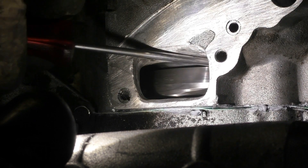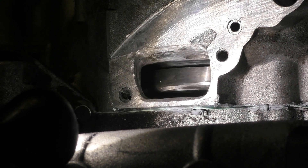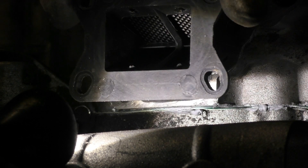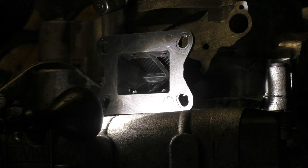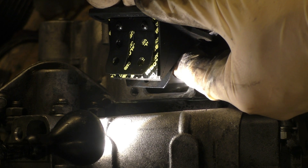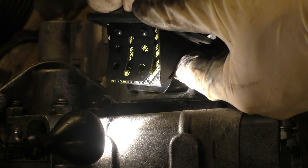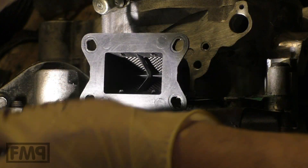Because look, I can put stuff in here and it even comes out where the conduit is. So we need something that closes. And here come the reeds. The reeds sit here. These are the reeds — they open and close according to what the cylinder exhaust is sucking, what it wants to take. They just open and close, and they sit here. And this is the reed valve.